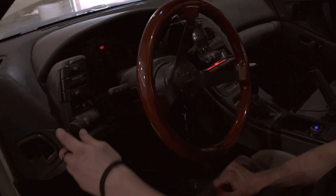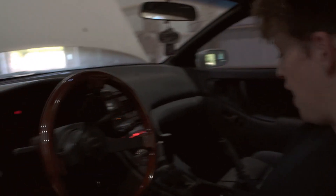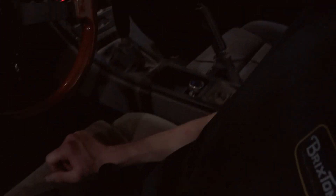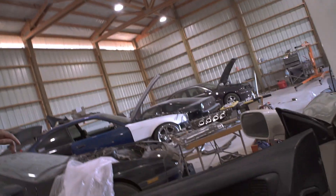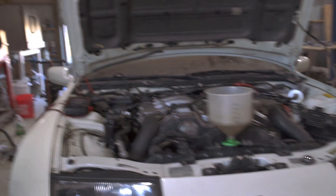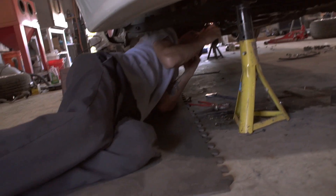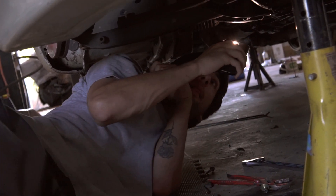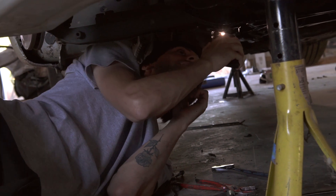Are your lights flickering? Yeah — then that'll be your alternator. Is that an overcharge? Do you have any voltage reading? We're reading 15, 16, 15.4, 16.1, 15.1, 14.3, 14.4 — and the lights are still flickering. Usually it's something like this — overcharging. The voltage regulator in the alternator is bad. That makes sense. And then it's usually a brand new alternator because I don't think these are serviceable.